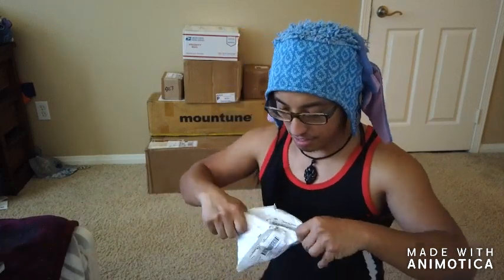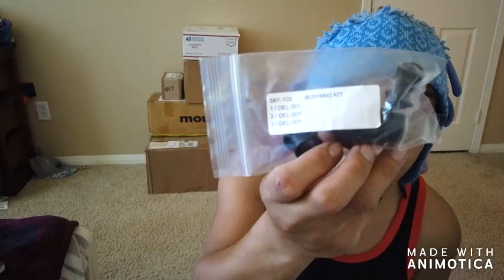I'm pretty sure I've told a handful of you guys this already. If you follow me on Instagram, I've mentioned that I'm gonna do a transmission swap on the truck, because the truck right now is a 4-speed. I'm gonna switch it over to a 5-speed, but not just any 5-speed. It's gonna be the 5-speed transmission that came in the 1983 through 1985 GTIs, which is a close ratio 5-speed. It's actually the closest ratio Volkswagen ever made, so it's really gonna perk up that engine, at least until it's time for me to swap it out. But yeah, like I was saying, it's my shifter bushings.